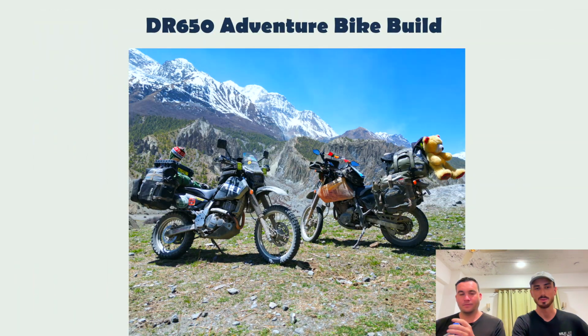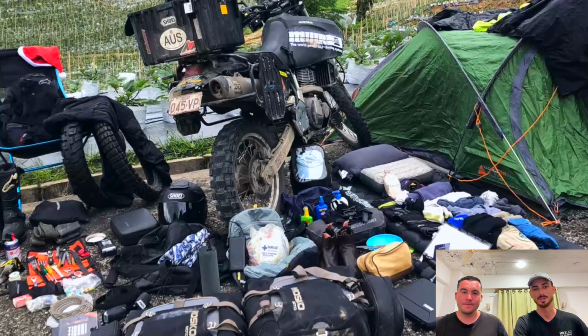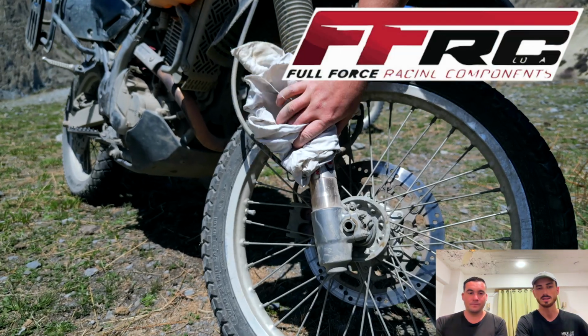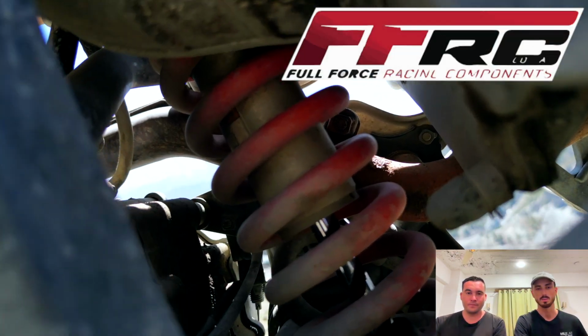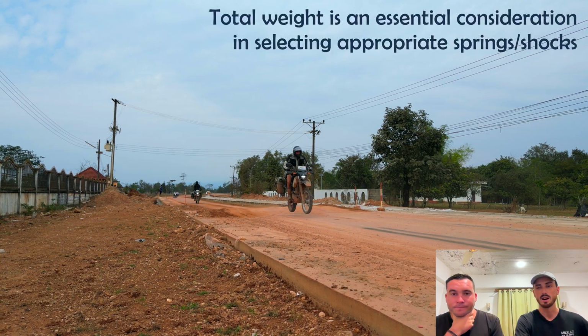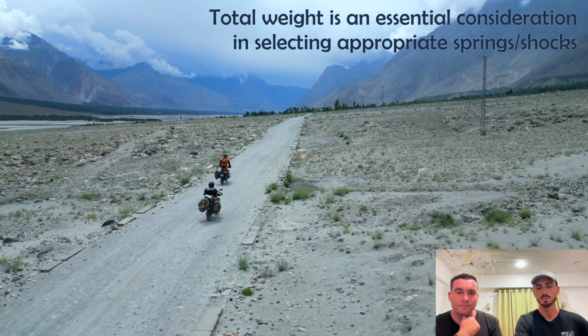So we're going to structure this video with a list, starting from what we think is probably the most important accessories you can have on your bike. First of which is your suspension. If you're doing a trip around the world, you're going to be carrying a lot of stuff. We went to a guy that actually runs, I think, a racing team. He replaced the springs with ones appropriate for our load, and then he revalved the original shocks. So he's gone in and put his own parts in there to suit the spring load.